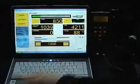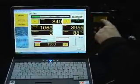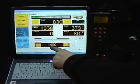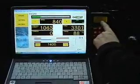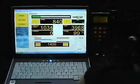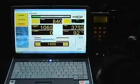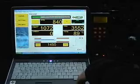Take it to 1300 there on the KTAR reading. Duration's beginning to fall, fuel trim not yet. Give it a little more. There's 1400. Injected duration now is 3.6, 3.7, and the fuel trim beginning to fall. Move along with the right and left arrow keys. Move it up to 1450 there. Still possibly a little bit more.